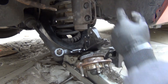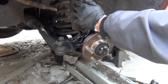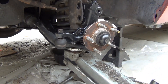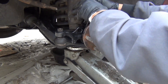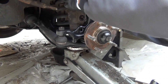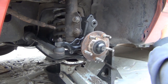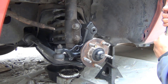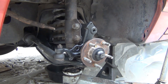What I'm going to do now is temporarily put the shock back on. Alright, so we're going to line this up and then use the jack to help us line up the holes. Alright, so I've got the shocks bolted up, so now I can remove the jack. And you can basically see that you have the 5-lug conversion bolted up to your car already.